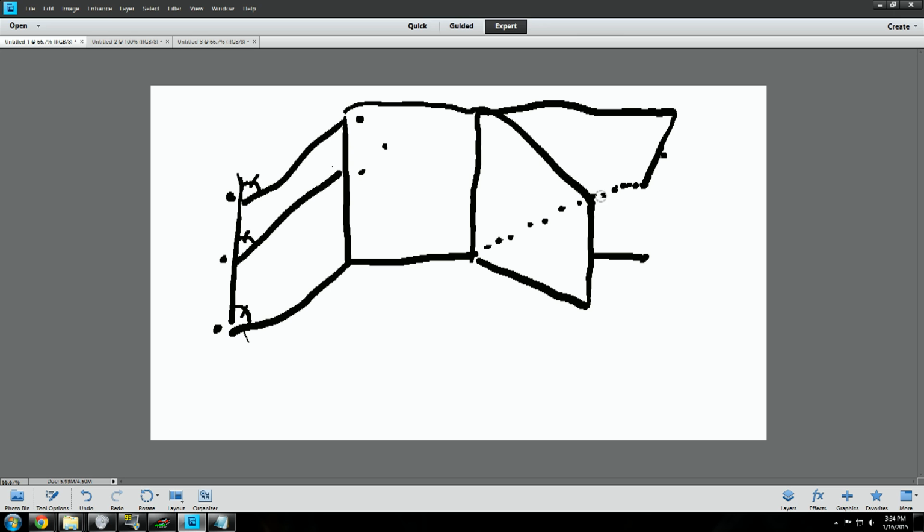Now keep in mind that this is all solid right here. Okay. So that means that your axle, and therefore your tire, is going to be angled down like that. And again, that's when the suspension compresses. So it angles pretty hard, down like that. You can get the same thing by changing it around and making this bottom one longer and the top one shorter. It all changes around your suspension geometry.